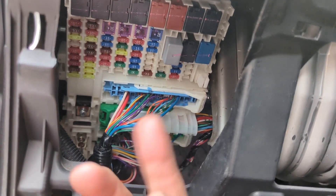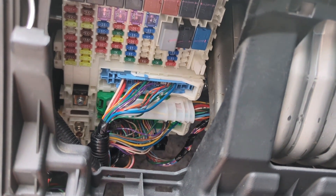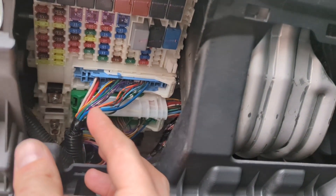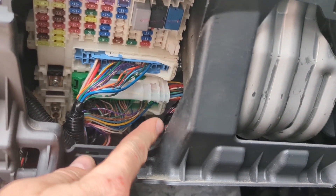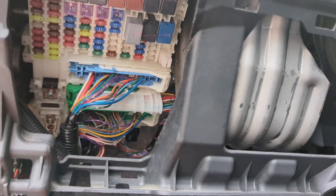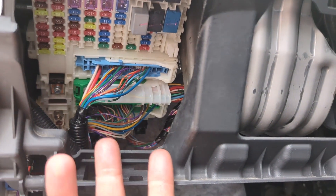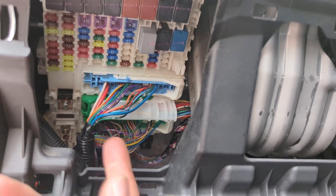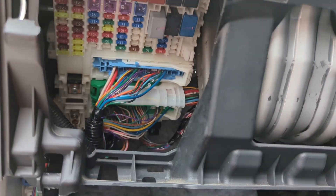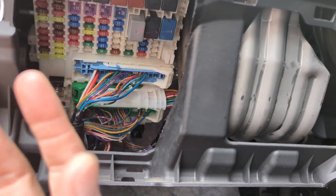The bracket for the EPS has a wire harness clip — one of those plastic clips that hold the wires. You have to remove that, and then there are two bolts on the bracket on the left: the top one you just loosen, the bottom one you take out, and the bracket will slide down. There's also a bolt on the right on the firewall. The bracket is an L-shape so it's hard to maneuver. You do need to take some plugs out to give yourself room. Definitely take pictures of everything before you start removing it — it makes it easier to figure out how to put it back. I dropped the bracket down, removed a couple clips holding wire harnesses, got around the harnesses to take those bolts out, and took the whole bracket out.